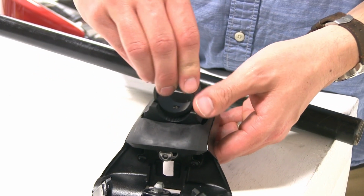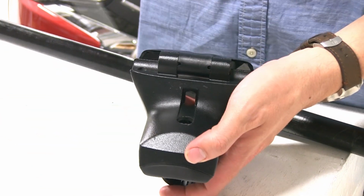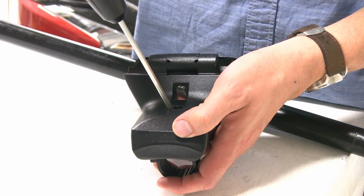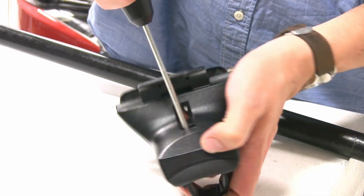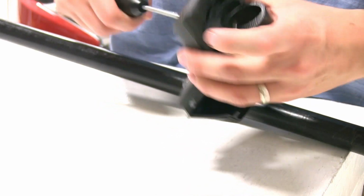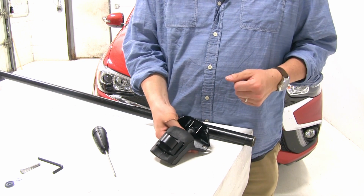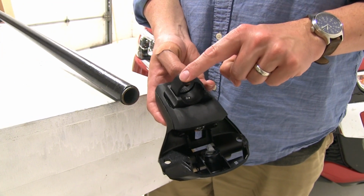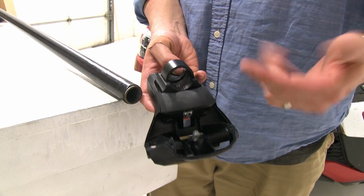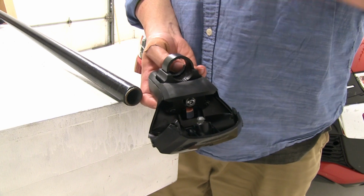It's a little tough to get it lined up. When you do, we'll flip it upside down to the tightening screw, take our included tightening tool, and tighten it down until you hear 2 or 3 audible clicks. And now we can slide this onto our bar. Now it should be noted it's still a little bit loose. That's only because we tightened the adapter piece down. Once we have this on the roof, we'll be tightening the screw in the center here, which will tighten the actual tower to the bar, but not before then.